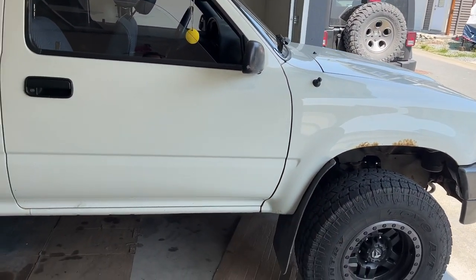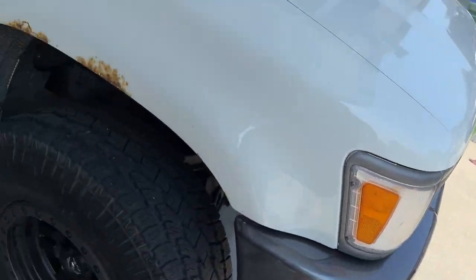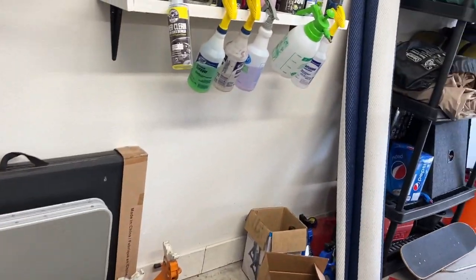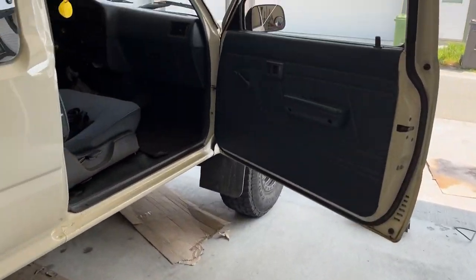Basically, all you need is the manual pedal assembly, obviously the transmission, and shifters. I don't have a brake pedal pad yet. I had a good donor vehicle to get some parts off of. I got the 5-speed from a 4Runner, the pedals from a 4Runner. I bought a brand new AISIN clutch kit and flywheel — a lux flywheel — off Rock Auto. I bought a brand new AISIN slave, also off Rock Auto. The master and reservoir was pretty new-looking, also AISIN, but that was off the parts truck.